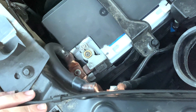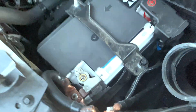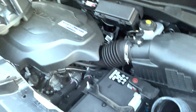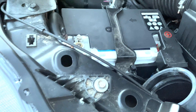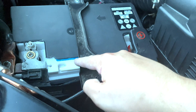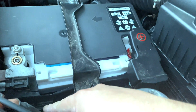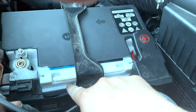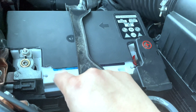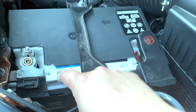Highly recommended. I'm curious to see if I'm going to have any of the electrical issues the infotainment system seems to have. I haven't yet. I have had it where the CarPlay freezes and you have to pull the fuse, but I haven't had any noises or cracking and popping. As far as installing the excess battery, I had to cut the box all the way around, all the way across, and then across the front. There's a fan down here — I actually have a piece of foam that goes right there to seal it off. This battery is just a little bit bigger, but it gives you about 15 more amp hours, and it's honestly just a much better battery than the Honda one.